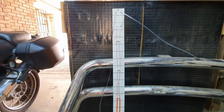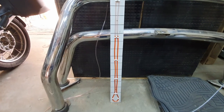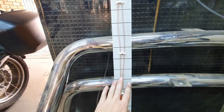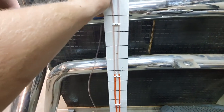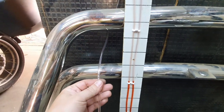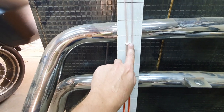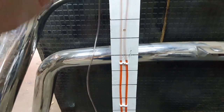Let's see the tool I've made — the synchronizing tool for the throttle bodies, or the manometer, whichever way you say it. Basically all I've done is taken a piece of wood — in my case, reclaimed pallet wood — painted it a lighter color so you can clearly see the difference between the liquid inside the see-through PVC pipe here. Every five centimeters or about two inches I drew a line so you can see the difference in height between each side.